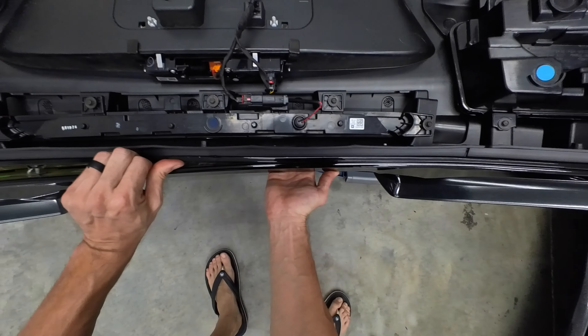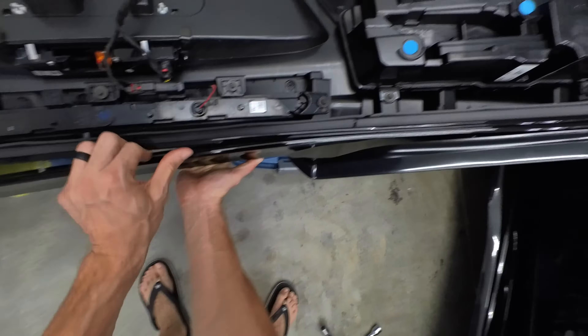Check this thing out. There's the three wires that we had to get off. Check out the exhaust system — that looks like we can save some weight when we get the Paragon exhaust. Two massive mufflers on each side. We just need the straight pipes coming straight to the outlets. But let's get back over to the spoiler. We got the bumper flipped over. It looks like the spoiler is held on by 10 millimeter nuts. After you get all those 10 nuts off, I wouldn't be surprised to find double-sided tape underneath the spoiler. Yep, we got some double-sided tape on there. It's like 100 degrees outside today in Florida, so this is coming off real easy.